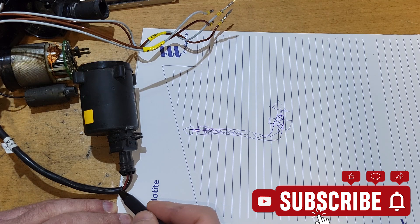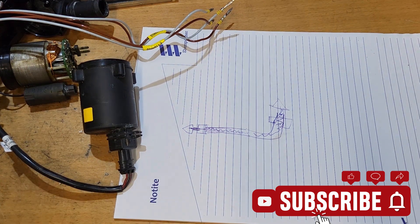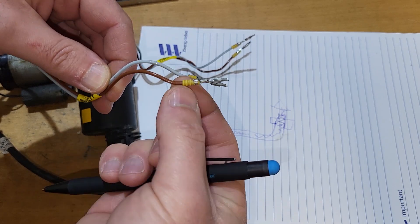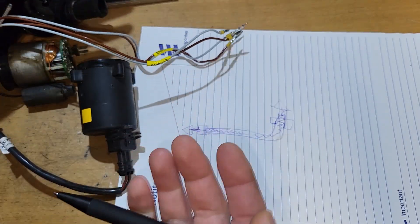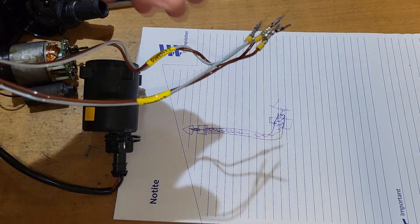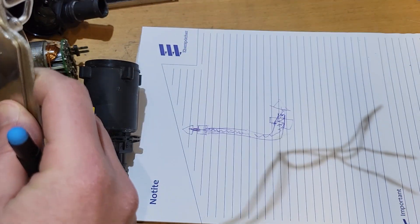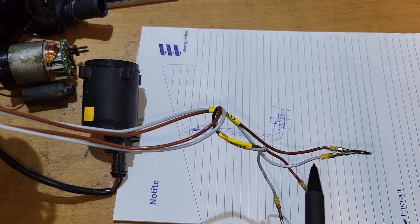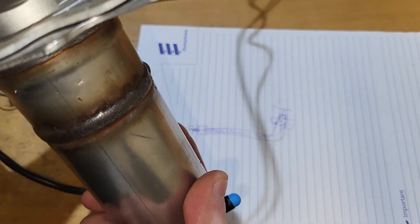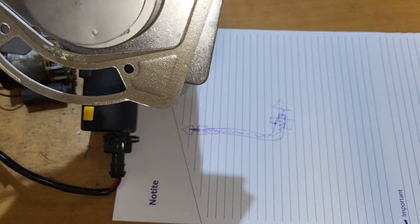All the water went through the copper wires and into the ECU — this is why from the outside we could not see anything. This just blew my mind; it's something I never thought would happen. We have insulation, rubber seals, everything sealed up, and yet antifreeze traveled through the copper wire. And because the glow plug wires were connected in the same place, the antifreeze came all the way back through those wires into the burning chamber — and that made the puddle below the burner.